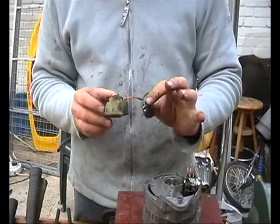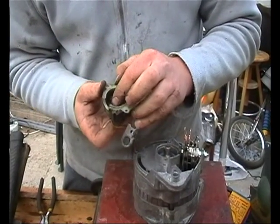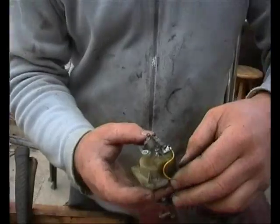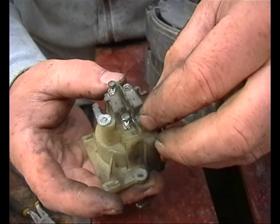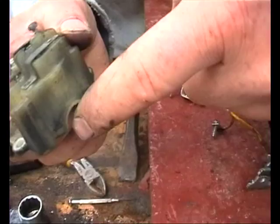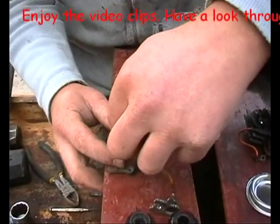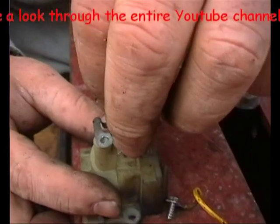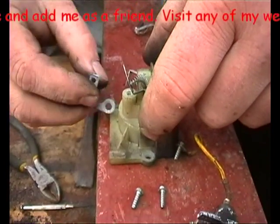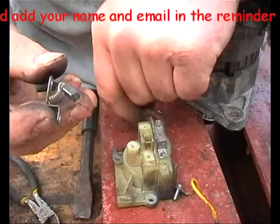That is a surge diode. The auto-electrical supplier said they never get asked for them, so we're going to leave that one on. There are the brushes — and there are the new ones. I've undone the screws; they're still in place so you can see the details of it coming apart. You've got to remember the position of where they go back in. There's the little semi-circular bit that goes over the rubber base. That screw goes in the top left. There's one of the brushes — one of the old ones — and there's one of the new ones.